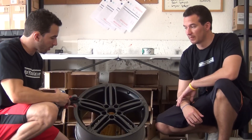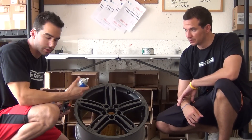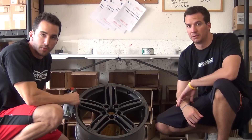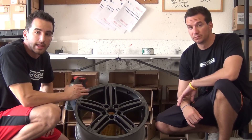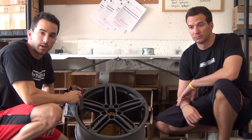We've got our wheel here. It's got two coats of the matte black original Plasti Dip. We've got our silver metalizer here and the spray trigger that we've been using for our projects. We're going to take it through one coat at a time — our first light coat, which is just going to give you a black wheel with a silver kind of metal flake to it, which has been real popular. Then we'll take it three, four, or five coats all the way up to that solid silver finish.